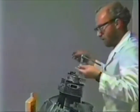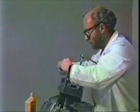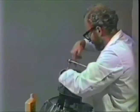Get out the 4 small head nuts, stick them on the top. Make sure you stick the hex head up so you can get the wrench on it. Snug down the nuts. Look at your pushrod tubes, make sure nothing funny is happening with them. They're all in place. Correctly arranged, seams up.